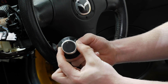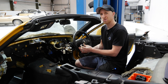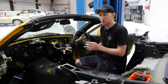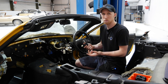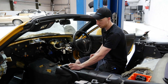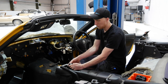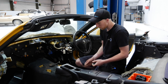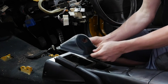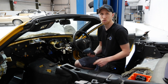It's a really nice gear selector - it lights up blue and there's a red LED that follows the selection you're in so you always know what gear you're in. Basically 12 volt positive and negative, and then you have a pin that goes live for drive and a pin that goes live for reverse. Pretty simple and straightforward. Originally we were going to mount it horizontally but it didn't look great, so we've taken the decision to do a CAD design and 3D print basically a lump here to tilt it backwards - and here is the finished article. That basically bolts in under there and this slots into it, putting it in a really nice, neat location for you to select gear.